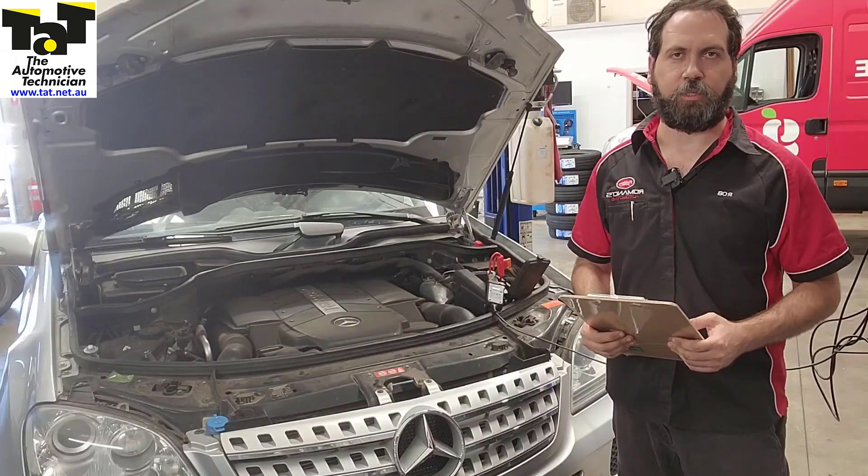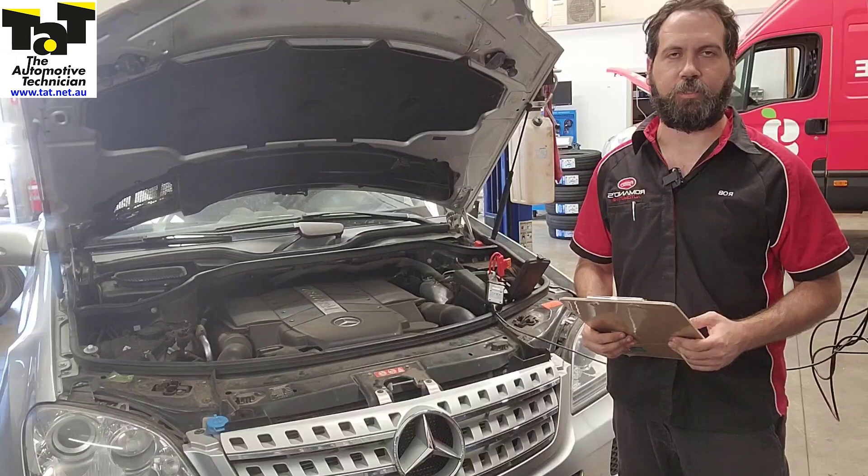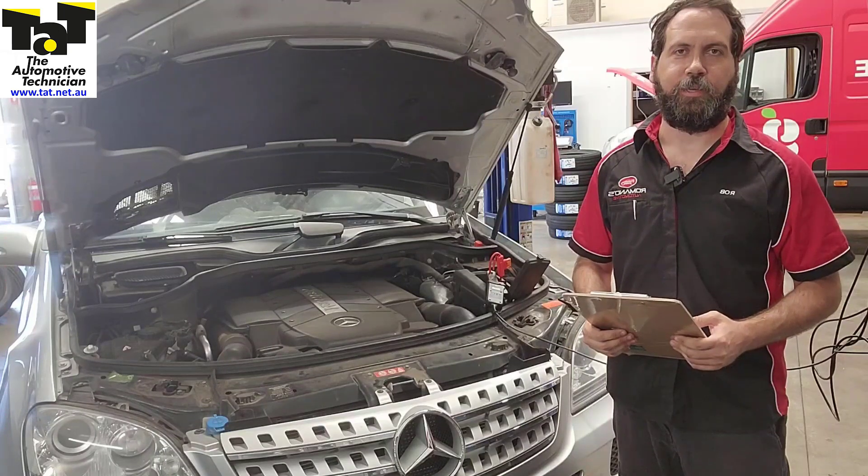So clearly, when this got a little bit hot, it was blowing the fuse. We advised the customer of what we found, and we'll speak to them about putting a new compressor in.